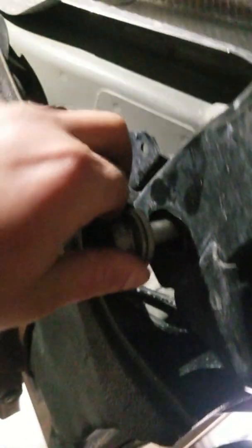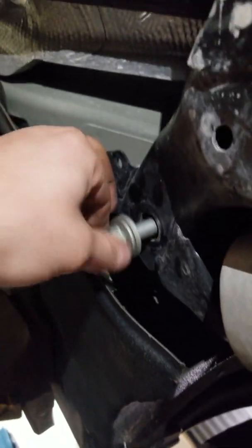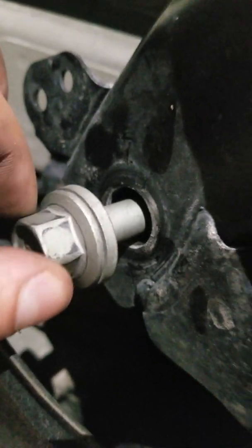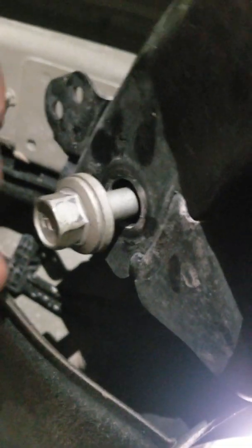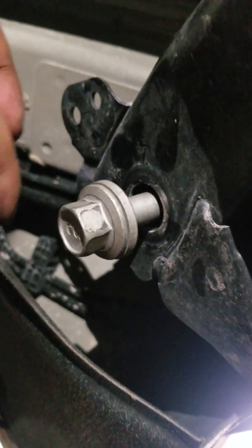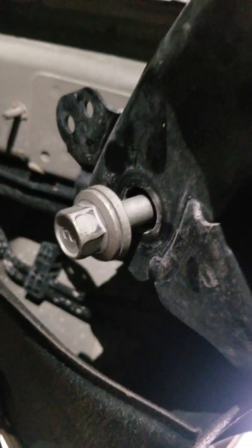So on all cars made after — well, it's actually kind of hard to see here — but this is the hole that this bolt came out of. So I'm putting the bolt in. The bolt's in place. You see that gap there? See how this moves? So over time, this allows your subframe to shift, and when you hit a big bump or pothole, this can dislodge the subframe and shift it. That's why a lot of the newer cars need frequent alignments, which is really annoying.